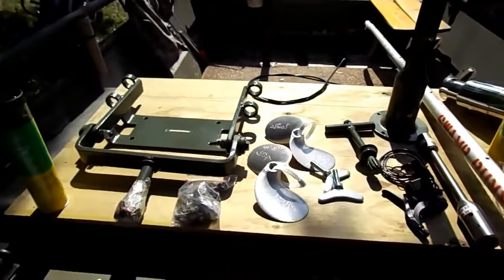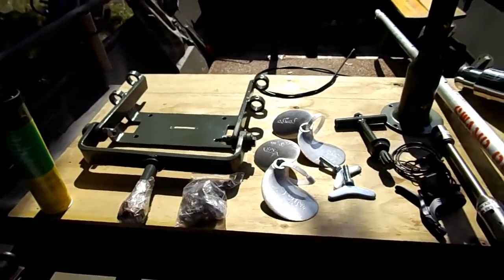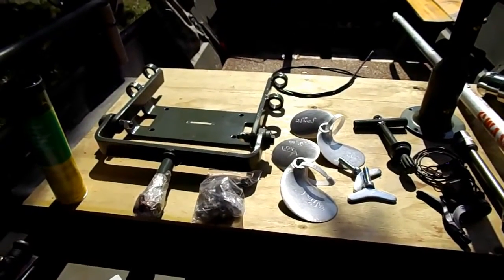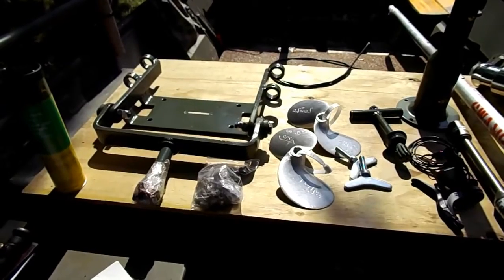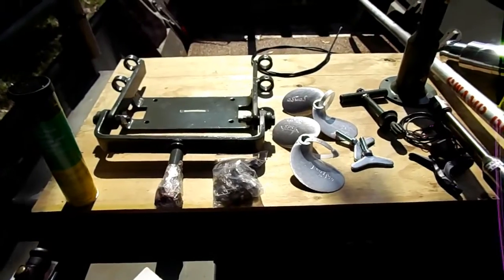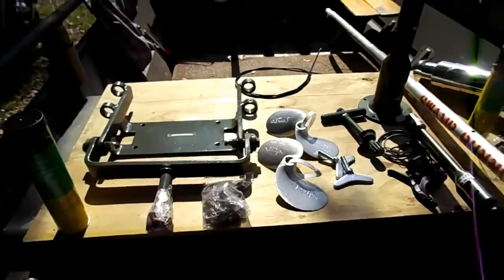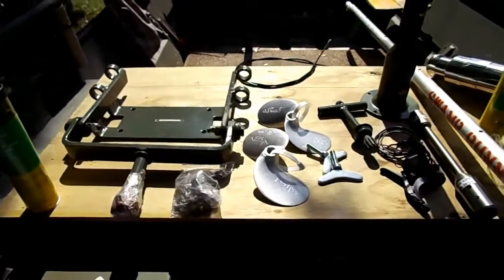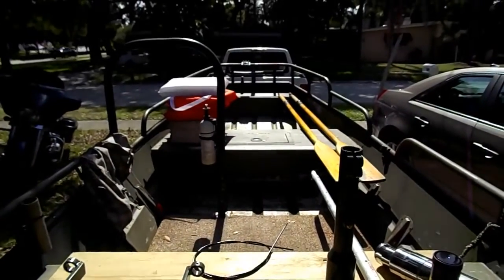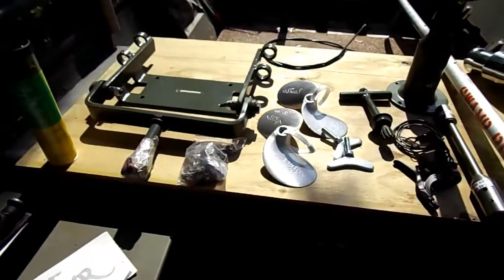One more thing I wanted to point out with this medium kit is, while I'm using this 13 horse Harbor Freight, I believe you can use from an 8 horse to a 16 horse on the medium kit. I should have checked before I started speaking. On their website, SPS Longtail Swamp Runner, you can get all the motors and all the different types that will work with this bolt pattern. So they really don't leave anything to guesswork. It's really easy to do.